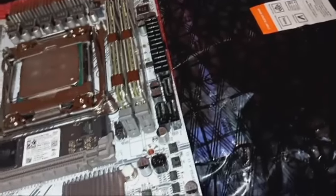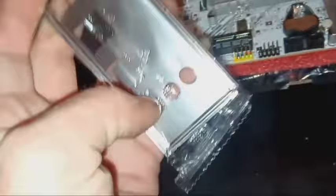I just got all the RAM installed - 64 gig on each side, two banks. Next I'm going to get the IO shield installed. I've got to bend this tab out of the way - that's for the ethernet port right there. If I don't bend that out of the way it'll cover the port, so you just bend it up and it'll sit on top. Then we can install the motherboard.